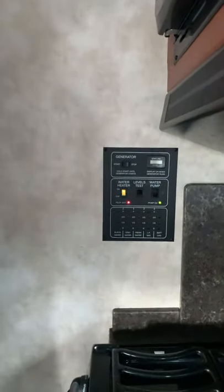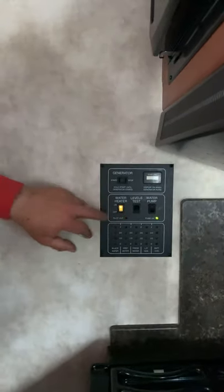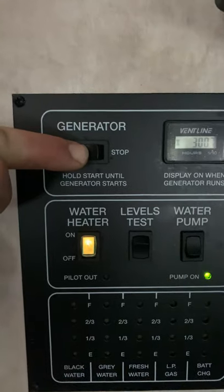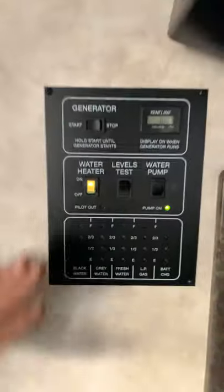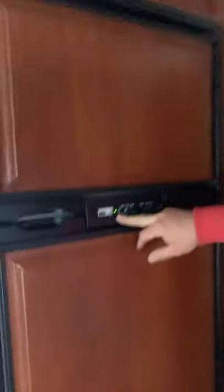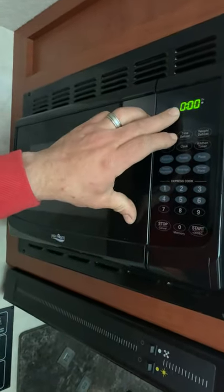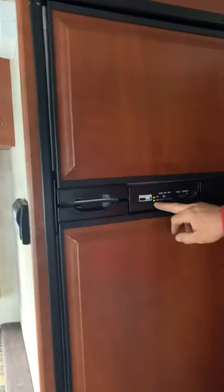It's always good practice — if you're near a dump site or a campsite that has a dump option, just dump it. Here's your generator. All you do is hit your start. They always start slow and chug at first — that's normal. Keep in mind that when the generator kicked on, my gas light went off on my refrigerator and my microwave kicked on. The microwave only works if you're plugged in or running off 110. When you shut it off, the microwave goes off and your gas light comes back on — now it's running off gas.